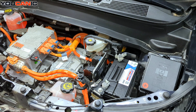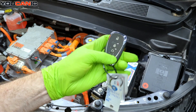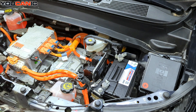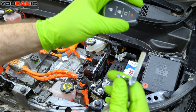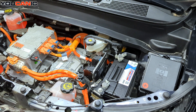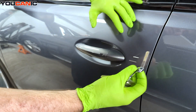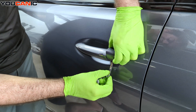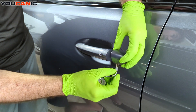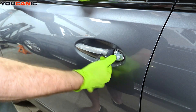So that being said, we may also need to get into the vehicle so that we can pop the hood. Say you try to unlock it with your key fob, whether your battery is dead in your key fob or the 12 volt battery is dead and you're not able to unlock the doors. What we need to do is unhook the fob portion to get your manual key out, and I'll show you how to use that to be able to unlock your door. You're going to come over here to the door — we have our manual key and you're going to feel right down in here, there is an opening for this key to go in, and then you can pop this cover off and put your key in to unlock it.